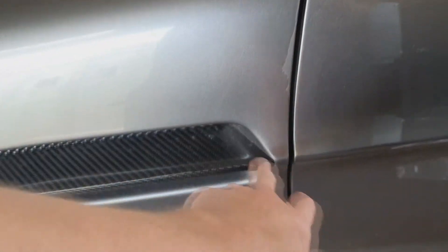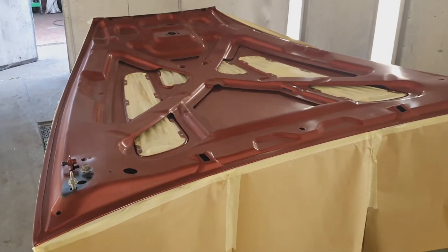So I've got a repair to do here. I'll try and catch it in the light so you can see it — you can just see, I think it's the edge of an old repair. I don't think it's a crack because when you press it, it doesn't move. That's going to be a quick repair. So I've masked this up, masked the headlight up a bit so it stops some of the dust, and I'm quickly going to do these little bits of repair here. Mask up all the bits you don't need dusty and mask them up. As my repair's done, I've flattened it and now I'm priming it to the car because it's a small repair.